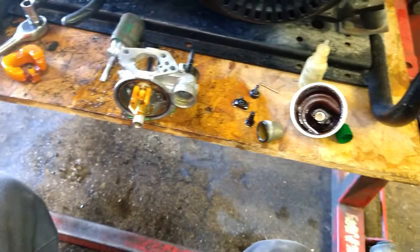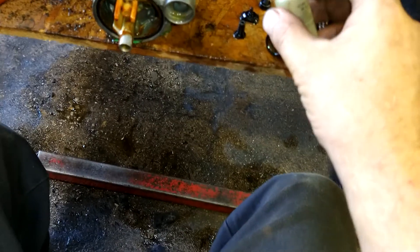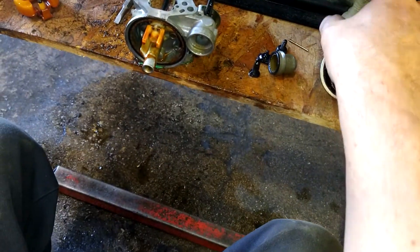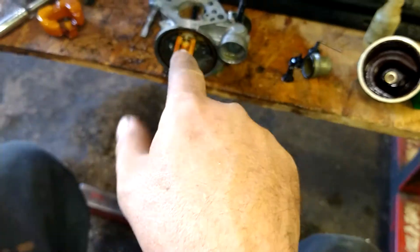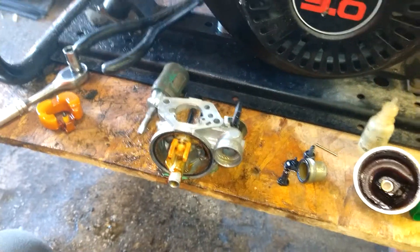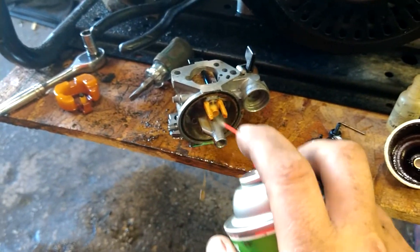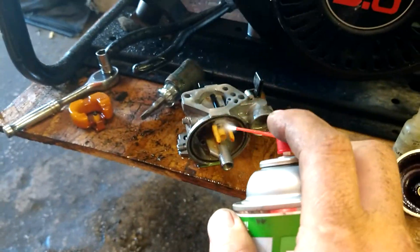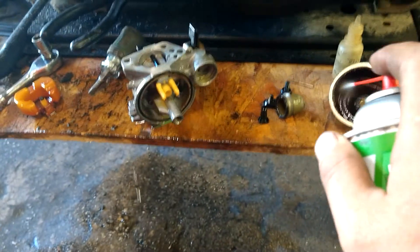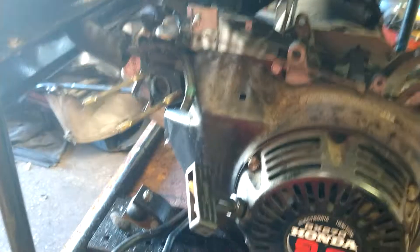Get some of that debris out, then put a drop of acid in it. Some have a little brass jet inside; this one looks like it does not. Spray very hard through all these holes — if it sprays out through them real good, you're fine. Then rinse off the rest of the carburetor to get all that tar out. You may have to rub spots with a finger or brush; give everything a pre-soak and get this carb cleaned up really good.